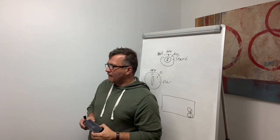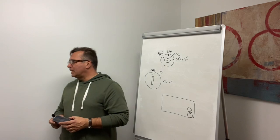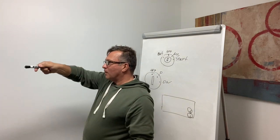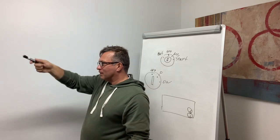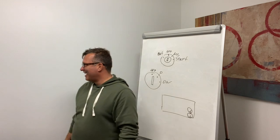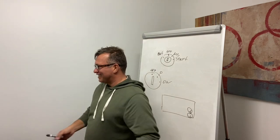Okay, 120, 140. It can be different, you can adjust it. Just a flat screwdriver, one minute and you adjust it, however much you want. Some guys do 150 because they have air tools with them. It's not good for the system, it can start leaking.